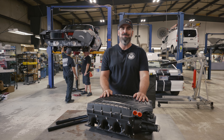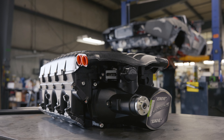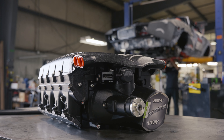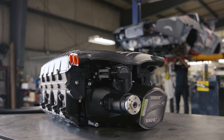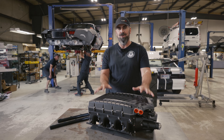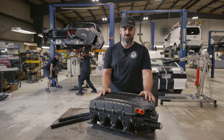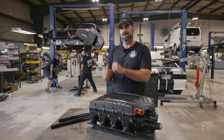For making all of the boost and adding power to our drivetrain, we contacted Whipple. They sent us their new Gen 5 3-liter blower. This is actually the model made for the L8T that's getting released to the public soon. It's got the intercooler on top instead of on the bottom. It should be good for all the power that we're trying to make. We're about to get it in the car.